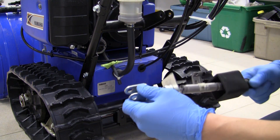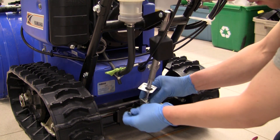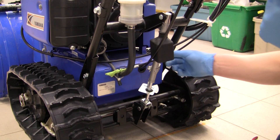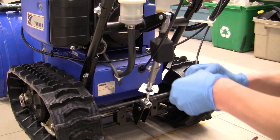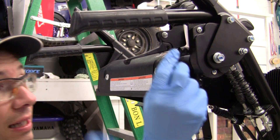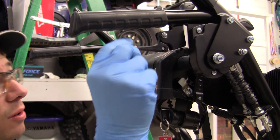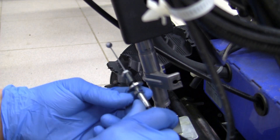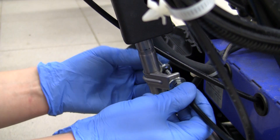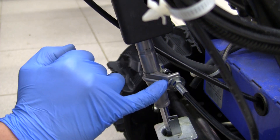I've left the bottom loose for now — we'll tighten that up after when we're aligned. We're going to proceed to installing this. We put our pin in on the top from the left, then put our washer, and down below the same thing — I might have to adjust the height a little bit. Then we put the cotter pins in there, loose for now while we make this adjustment. We need to grab the cable — I've got it taped up from before because I had to use the blower. Now we take this cable assembly. With all the slack at the bottom, get this cable back into the lever — we can just make that angle without taking the lever off. Now the cable's secured up here. Stick it through the rubber, back the nut all the way back, and have the nut and small washer floating off the end. Then stick it through and get the ball through the cable to secure onto the back mechanism, then tighten up the nut. The rubber is actually going to sit behind this large washer.